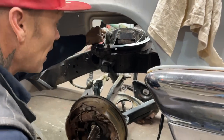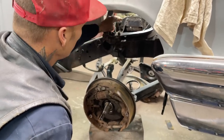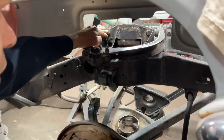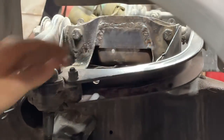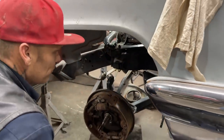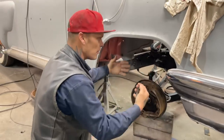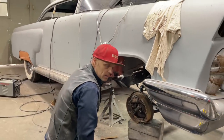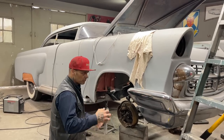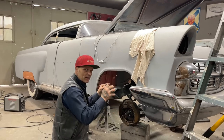And like I always say, when I think of gussets, and what I mean by gusset is I mean help, this flat piece here, that's where the upper control arm is bolted on. It's shimmed on the other side for in and out for your wheel. Years ago, when they built cars, things were put together and shimmed. Nowadays, I don't work on many new cars, but all the cars are basically where the bolts are is where the holes are, and that's where it goes on.